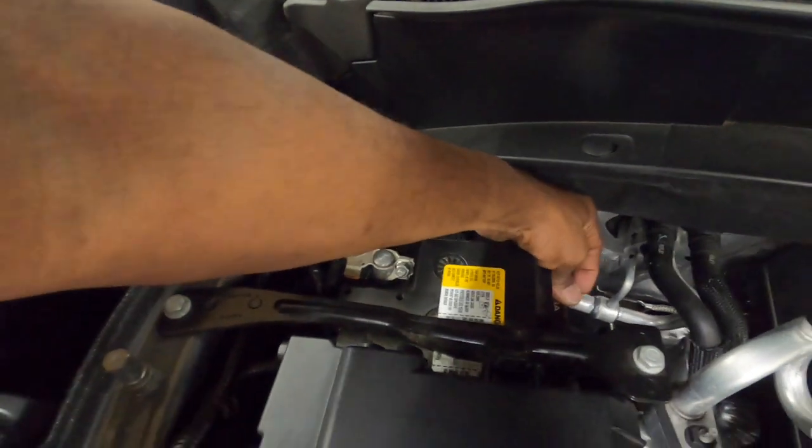When doing a battery connection on any vehicle, make sure it's actually mounted to something and doesn't move — just in case there's an accident or something doesn't work right. When it's all said and done, you want the customer's car to be safe. That's why you mount all your hardware. Fuse holder made, mounted here on a solid bracket, tapped in tight.